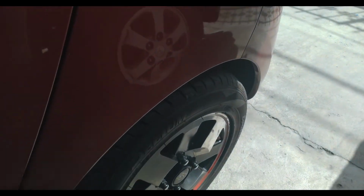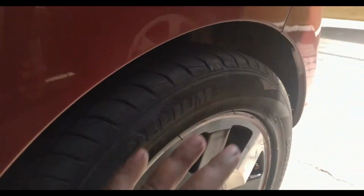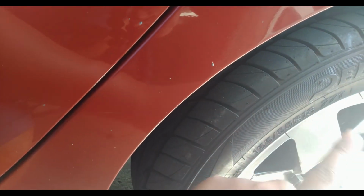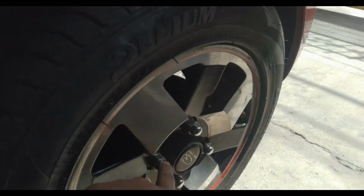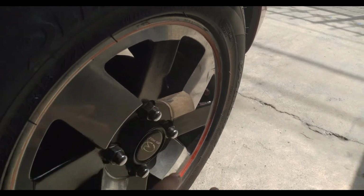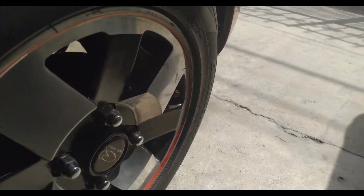All right, and also aside from checking the tires itself for any physical damage, if you have a tire pressure gauge, it would be great if you can check the pressure and follow the recommended pressure on your tire size. I do have a video about tires. I'm gonna post it in the description section below. And double check the wheel nuts. Just to double check that there's no loose lug nuts on all four tires.